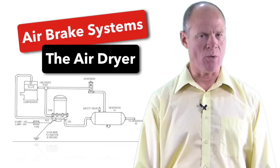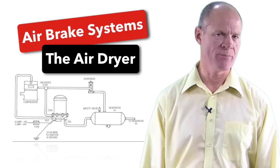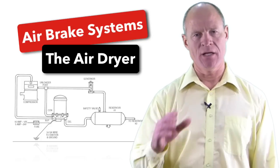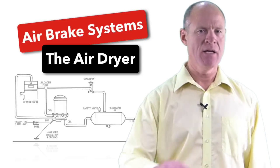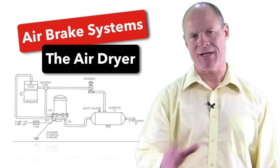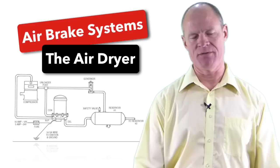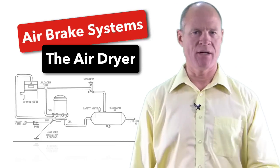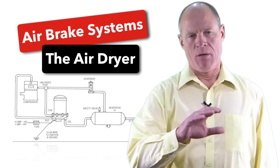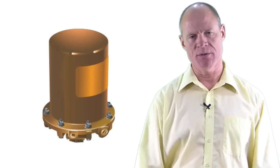Because we react to sound first, we're going to hear the air dryer purge. On some of the newer systems, the air dryer is actually going to be quiet, so you're going to have to roll down your window and listen for it to purge to know the system is at maximum pressure. On older systems there's going to be a wet tank, and the air dryer will be between the compressor and the wet tank. Most air dryers in this day and age are all shaped like a top hat — you can see a picture of one here in the image, and that shape tells you it's the air dryer.